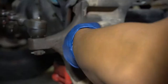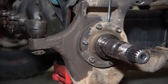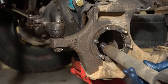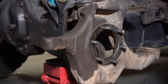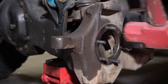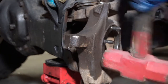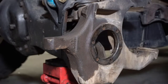After the hub is removed, you have to then remove the spindle, which is held in place with six nuts. Then the axle shaft can come right out. Be sure to put a pan underneath the front differential because oil will leak from here. After the axle shaft comes out, we then have to punch out the existing spindle studs and replace them with some longer spindle studs — you can use the ones from the donor axle or new ones made for the longer 8-lug setup.